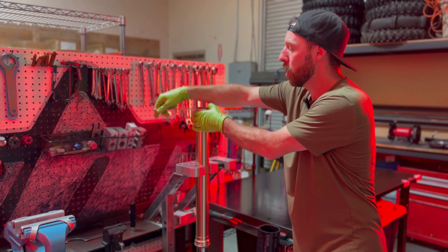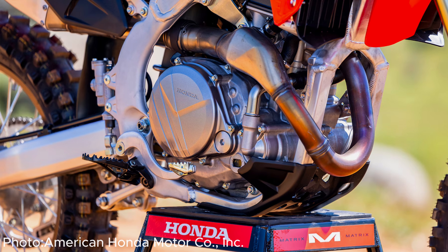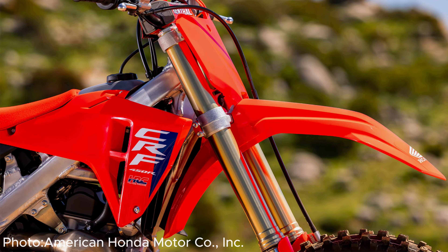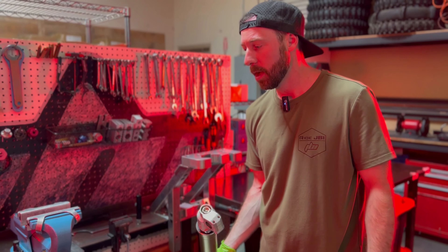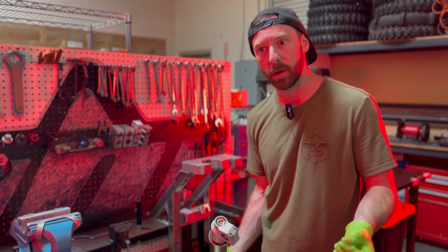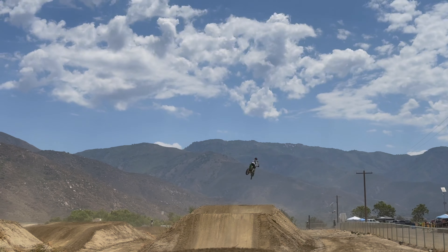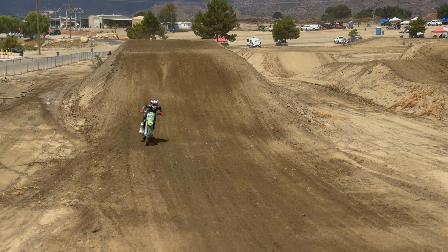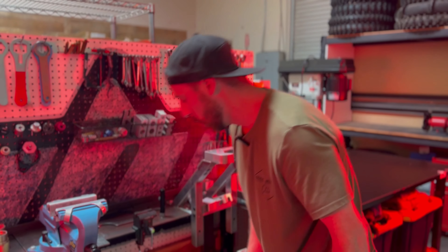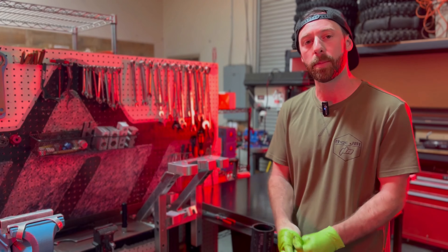It'll be pretty similar to what we did with the 2024 Kawasaki — we're going to rely on our previous experience with the 2017 to 2023 model Hondas and the specs we already have as our starting point. Then we'll learn how that works with the new chassis. In simple terms, when the chassis gets better, the suspension just tends to work better. So more than likely the settings we already have are just going to perform and feel even better on the new bike. Because of that, we're going to make some specific changes as well. If we have a more compliant frame, we can usually run suspension settings that are a little bit firmer without them actually feeling firmer. We'll let these sit and drain, then continue pulling them apart.